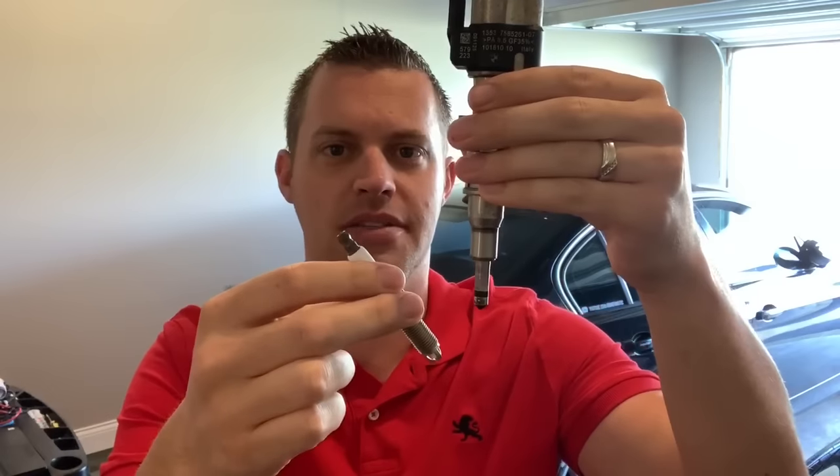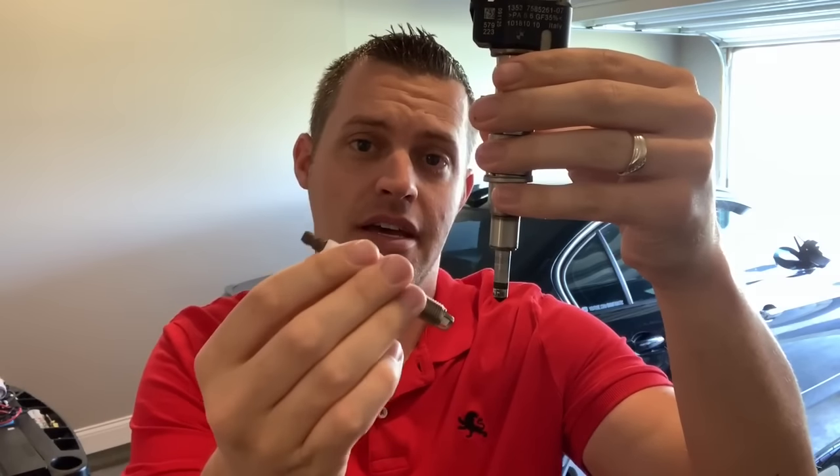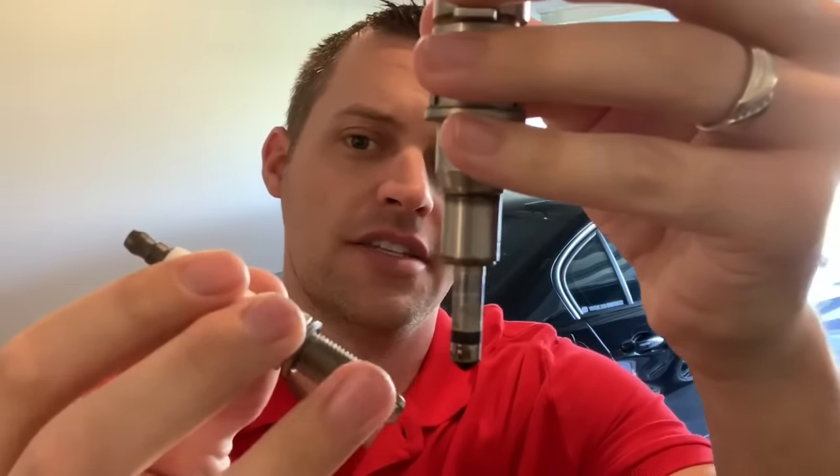The leaking part shows up on the spark plug. You've got your injector here and your spark plug right about here. For demonstration purposes, fuel leaks out of your injector and gets onto the tip of your spark plug. When you go to start your car, it starts fouling out that plug and your car is going to hesitate, not fully start, or sit there and misfire like crazy.